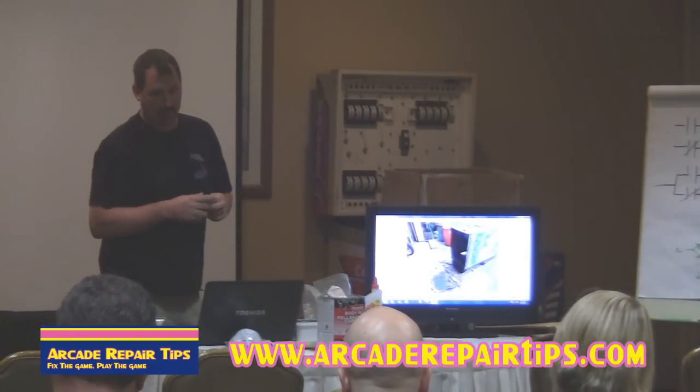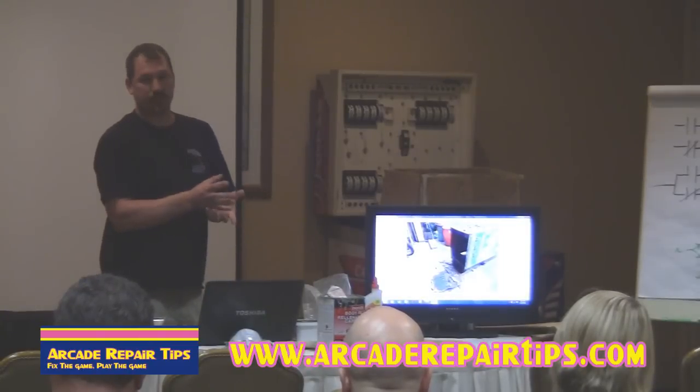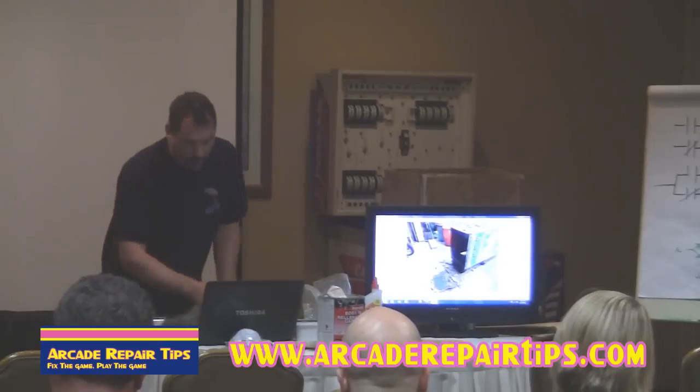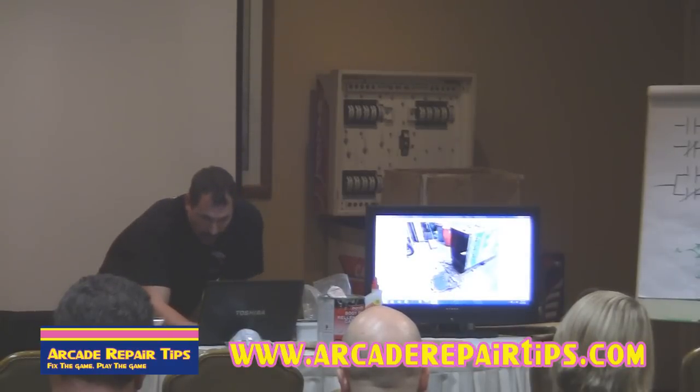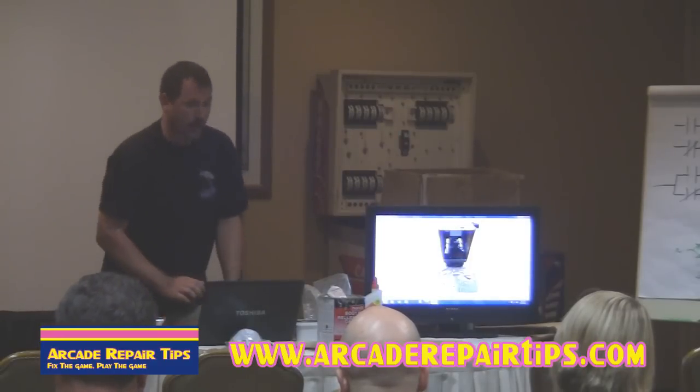So you can foresee why they used particle board, but after years in the laundromat getting wet from washing machines — good and bad. Basically you have to evaluate — can I save anything on the bottom? If not, take the parts off the bottom, save the levelers for later. Some are so rusted you'll need to replace them. Then look at what's good on the machine.